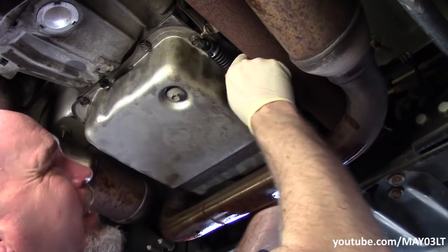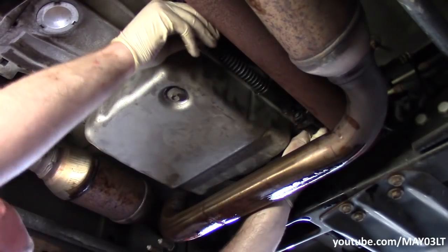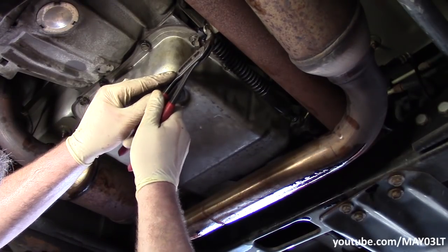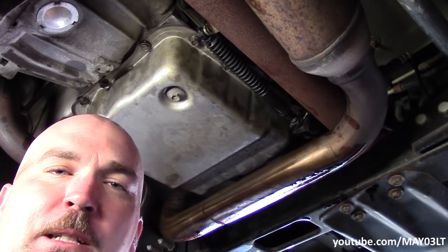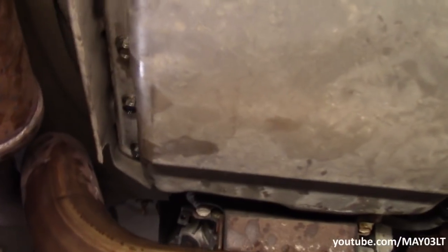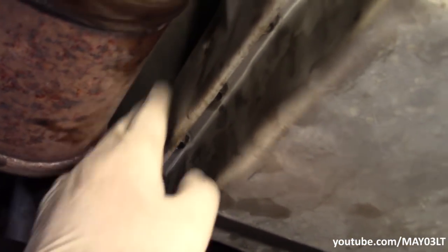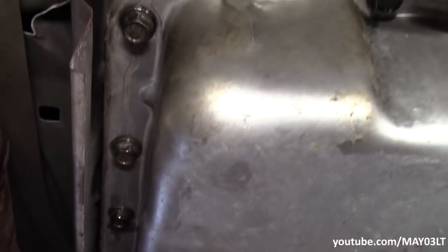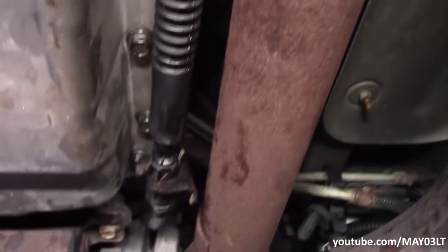Go ahead and get this shifter bracket back up on here. I couldn't really feel if this thing's seated all the way. I'm not going to show you putting those invisible bolts back in for the shifter bracket, but believe me, I'm going to put them back in. To get that cooler line off I took this heat shield off — it's on the passenger side. There are two 10mm bolts that hold that little heat shield on there. Its purpose is just to protect the transmission from heat from the catalytic converter. The service information didn't say it has to come off, but it did make cleaning the pan mating surface a little easier.